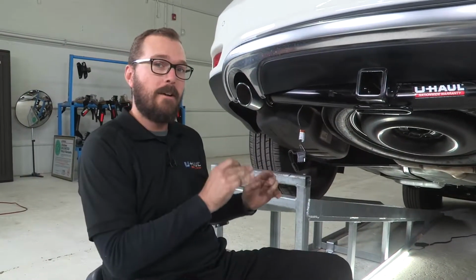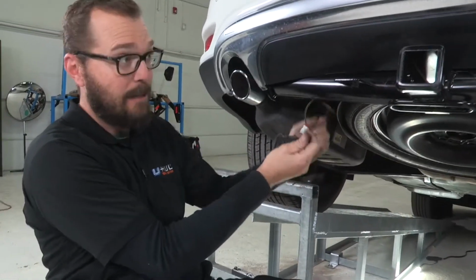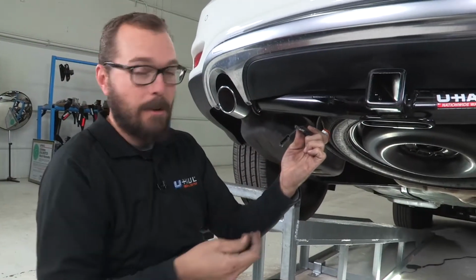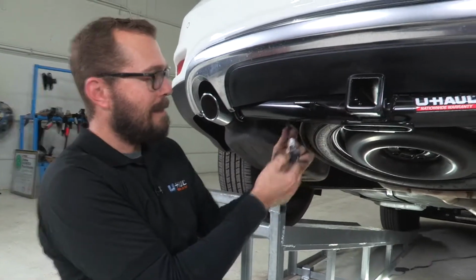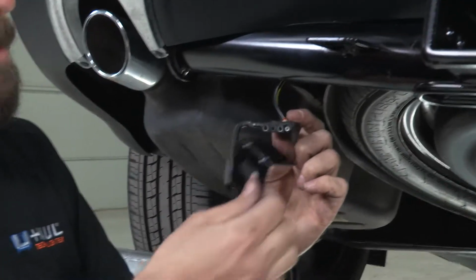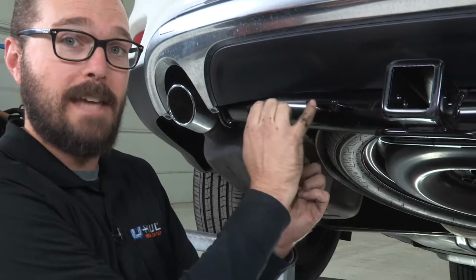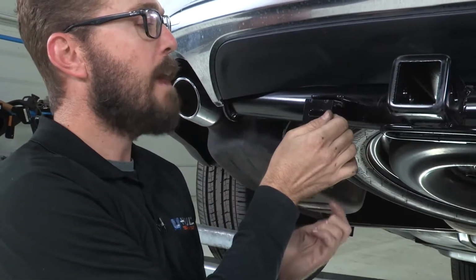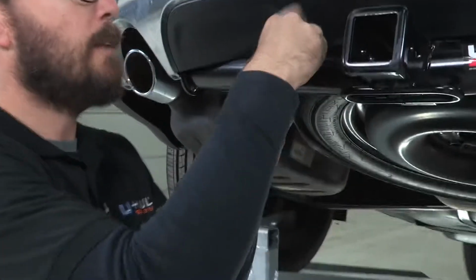Okay, with all of our wiring connections now made, all that's left is our 4-way flat lead that's going to connect our vehicle to our trailer or the lighting system on our cargo carriers or hitch accessory. And as opposed to just having this lead hanging or zip tying it off somewhere, spend a little extra and you get a bracket, because the hitch manufacturers have included this tab, and this allows you to mount a modular bracket that we've got here to secure our 4-way flat to.